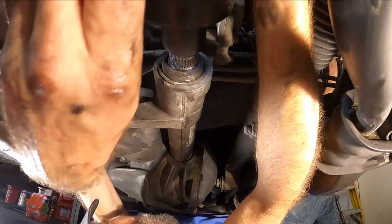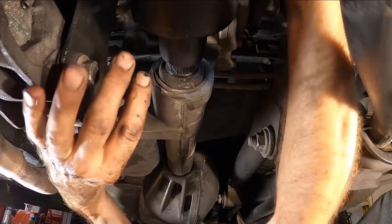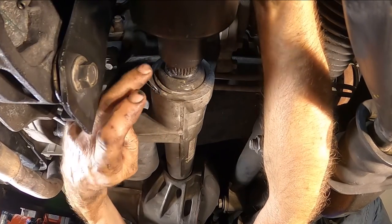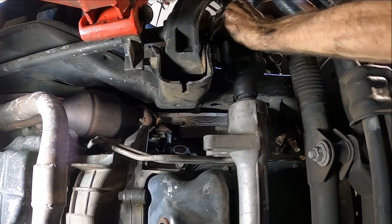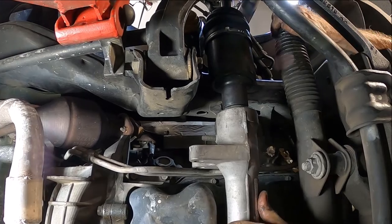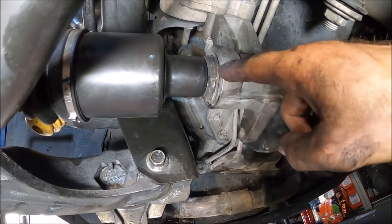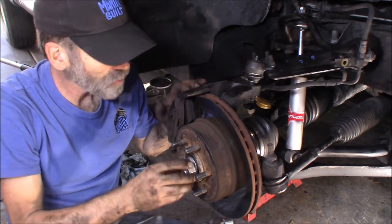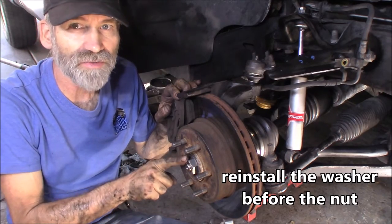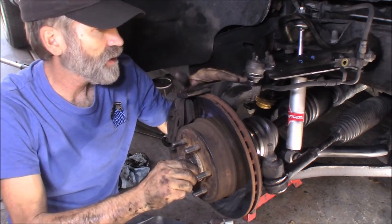What we've got to do is get that axle shaft to go over that C-clip on the stub shaft — just get it to be locked in and secured in place. There's a C-clip right there; we need to get that to go on there. It'll be flush up against this surface right here. Got it. This is how it should look when it's installed properly, all the way flush up against that seal.